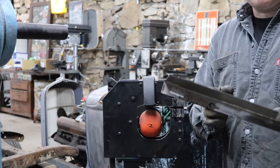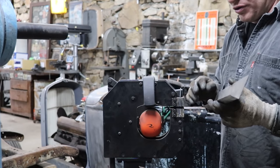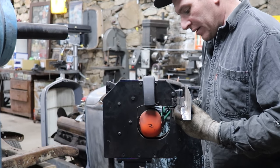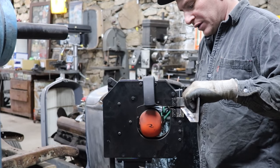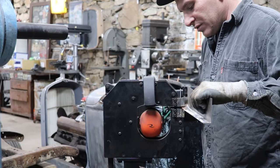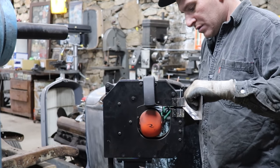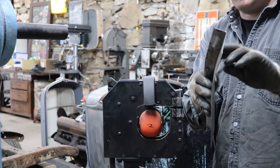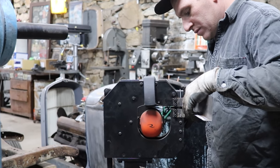Alright, so I made some marks on the metal we cut. I put it in the brake and bent it 90 degrees. I made a mark where the majority of the stretch needs to happen. We're using 18 gauge steel here — that's what it seemed to be in the door jamb, approximately. I'm going to hit the pedal, watch the metal move, then move over and do a little bit less on the next one, probably even a little less on this one. I can see the piece is starting to get a curve to it — I think we need quite a bit more than that.